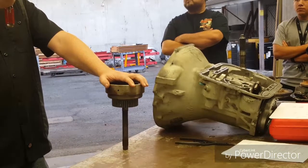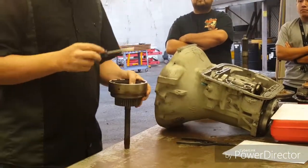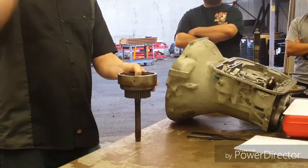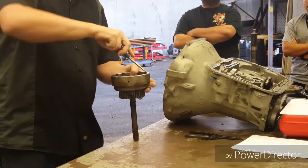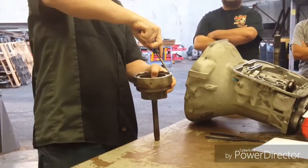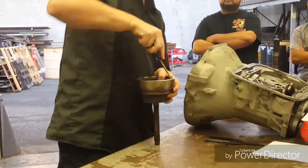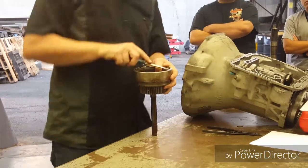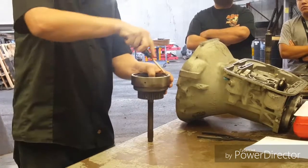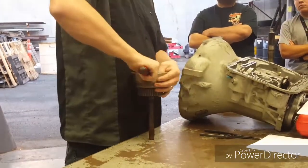Some of them I made the tip a little bit sharper so I can dig into it, just for specific ones. But the technique you want to start getting used to is: don't just dig straight into them. About 45 degrees — a little bit of an angle. If you just start to twist them side to side, you can see how I can get it to pop in there. If you try digging straight down, it doesn't work. If you go too steep, it doesn't work. It's that 45-degree angle that makes all the difference — where you can pop it in and get it to come out.